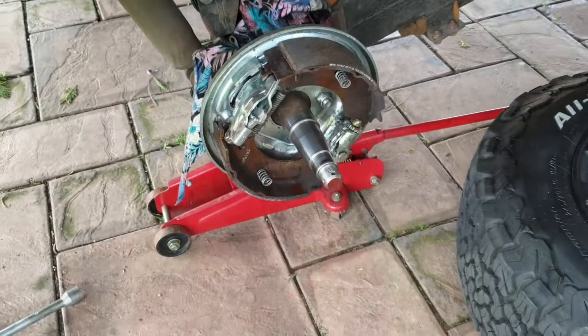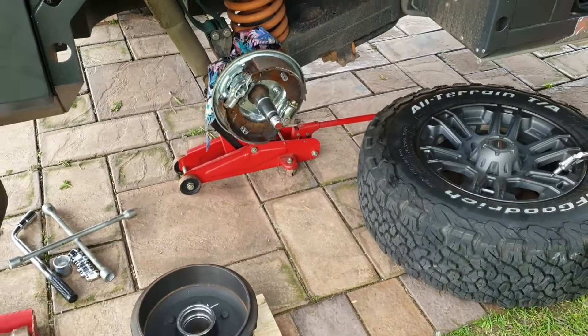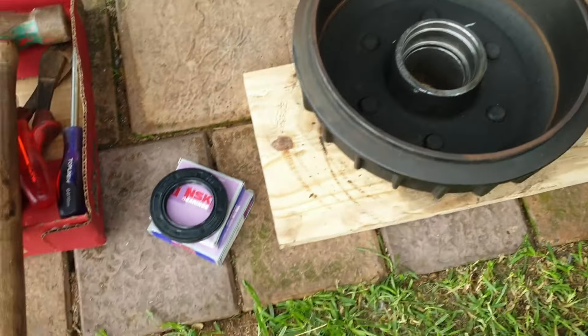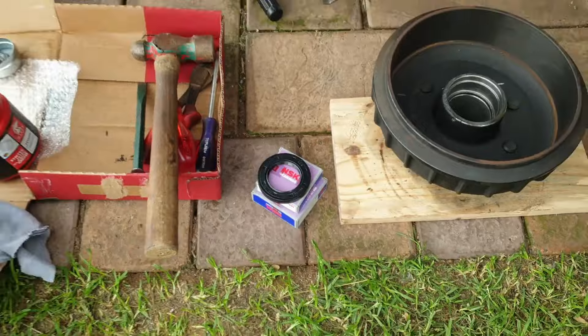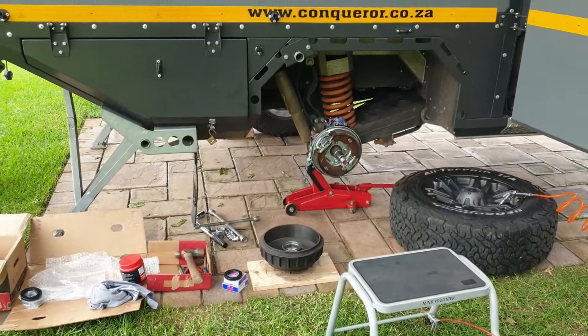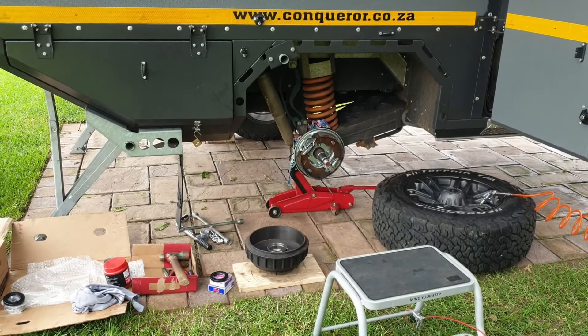The way I clean it, take care of it, maintenance. Here's a short video of the maintenance I performed yesterday. Every few years I strip the wheels, inspect the brakes, the brake lining system, the brake system, replace the bearings — the inner and outer bearings — and the dust seal. That was done yesterday, and I had the help of Harry Chatterton who came over yesterday afternoon. It was fun.